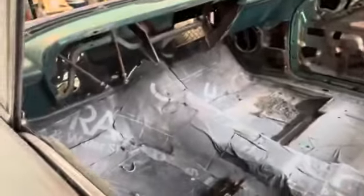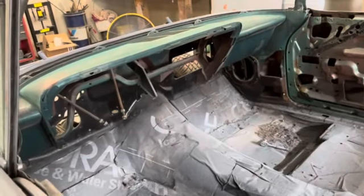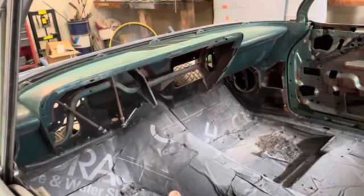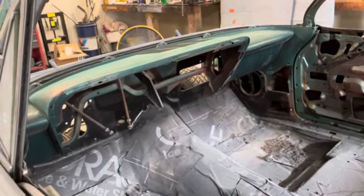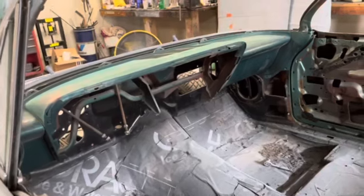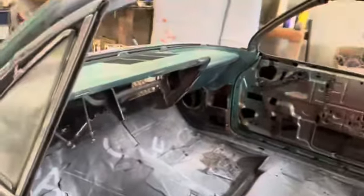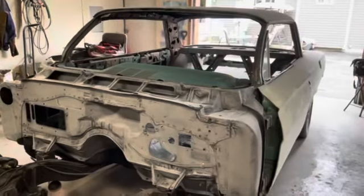In the next several days, I would like to get this dash painted. I'm going to have to push this out and blow all the dust out of it. With that black paint, I don't want to get any dust on anything, and kind of tape some things off. And I think it's going to be better to paint that first and then let it dry for several days, and then paint the firewall. I don't want any black overspray up on that firewall. A little green overspray on the back of the dash, it's just spray can dash paint, I think that'd be a little easier to fix. Hopefully that doesn't happen either. Okay, so I'll pick this back up tomorrow.